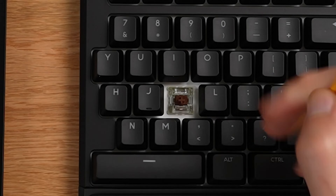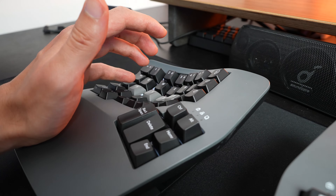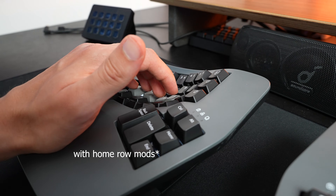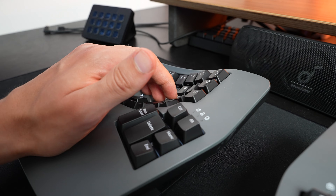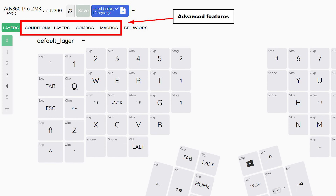The Box Pink switches are definitely very light, very quiet, and very well suited for an office environment. When I reviewed the Kinesis Freestyle Edge, I really ended up liking its brown switches and missed the tactile bump, which signals to my brain that I've activated the key and allows me to bottom out less, reducing finger strain. One major benefit with the Pink switches is that because they're so light, it's so easy to hit multiple keys at the same time, especially on the home row — for example, key combos with Shift, Control, and Alt plus a letter are just effortless.